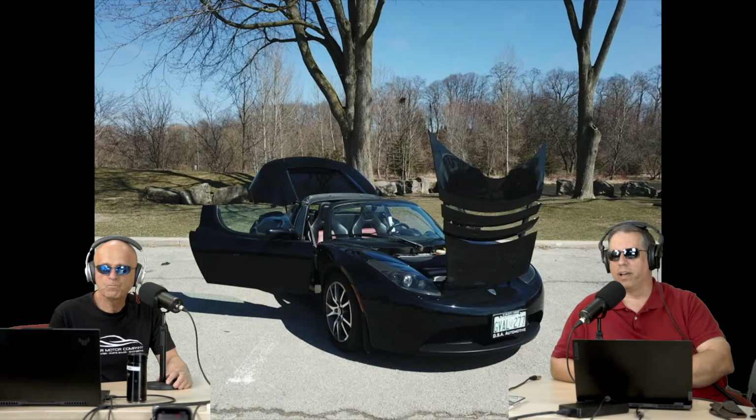Now on TikTok, we have a question from North Maze, who asks, how many kilowatts can the Roadster charge, and how much kilowatt hour capacity does the battery have? So I'm thinking the kilowatts is how fast. Well, the charge input rate is anything from 70 amps for the Clipper Creek charger down to 15 amps for the yellow charge cable. The capacity of a legacy Roadster battery pack is 53 kWh. For the replacement 3.0 packs, it's actually 80 kWh.